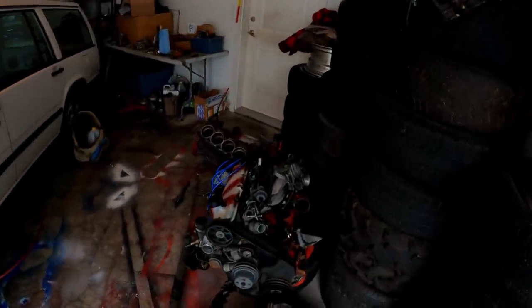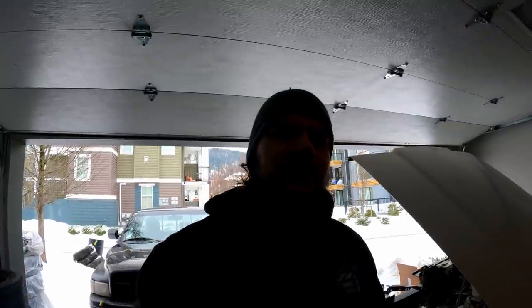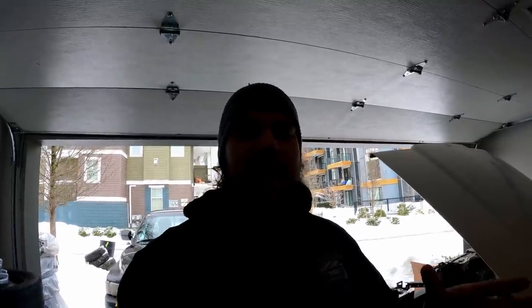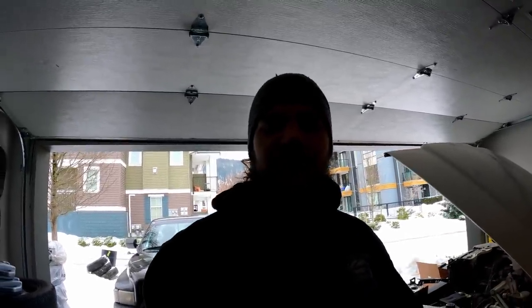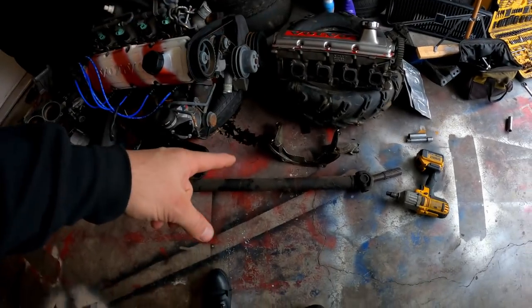Also guys, the panel wagon, you're probably all wondering what's the deal with the panel wagon. I'm actually just waiting on a center support bearing. So what I did is I got the M90 front half of the drive shaft that Dennis Blom sent me in the crate of stuff from Sweden, and I took it to a driveline shop and I'm getting them to balance it with a rear shaft. So I had another one of these, I brought it to them.